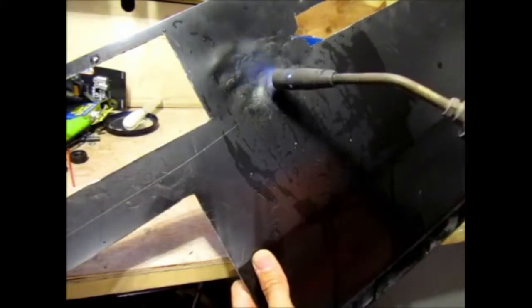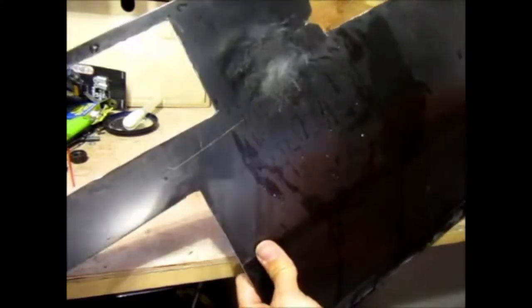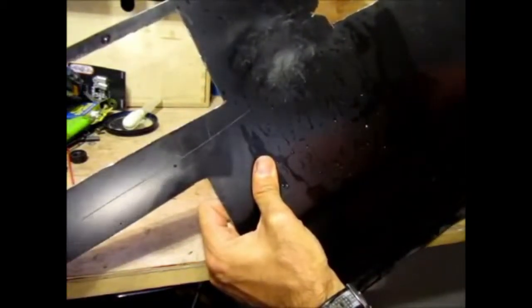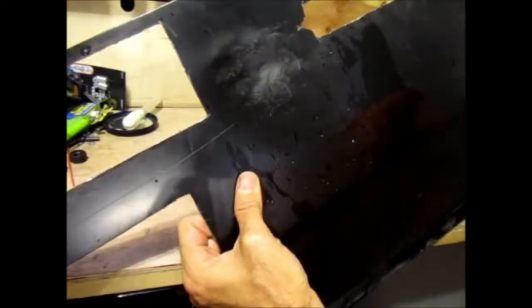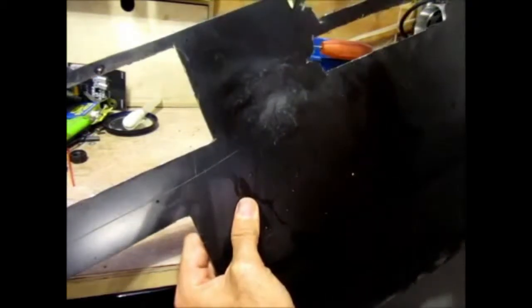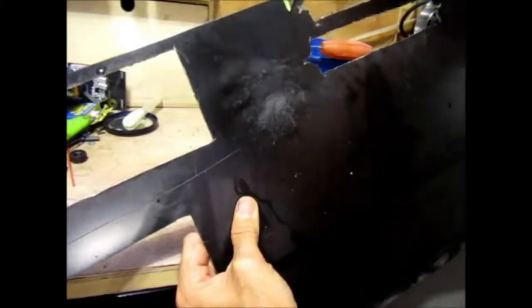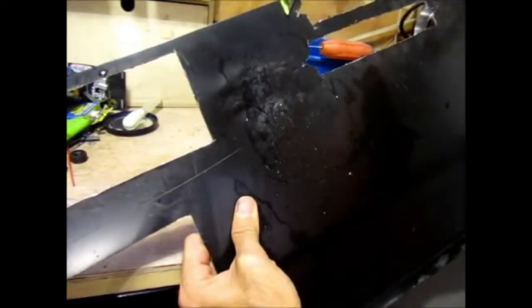And I just concentrate on that one area. And then while it's hot, since you know that the metal stretches, you want to hit it basically on the back side. And you could use a dolly, the hammer and dolly method, to aid you. While it's hot, you can move it and do some flexing because the metal is now soft. And then after you get it to where you want it, you just cool the metal again, okay? And that will lock it into position.